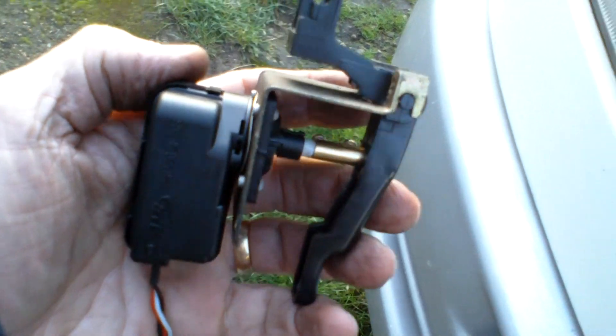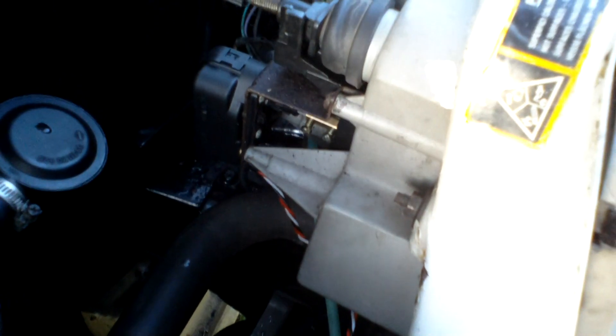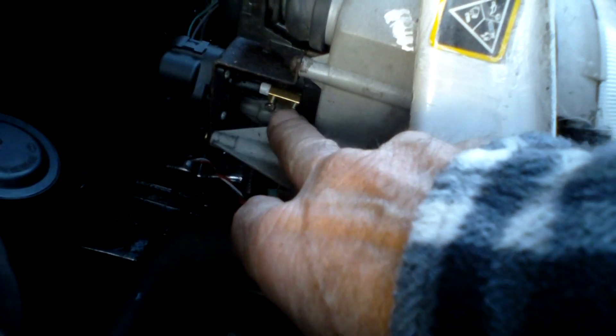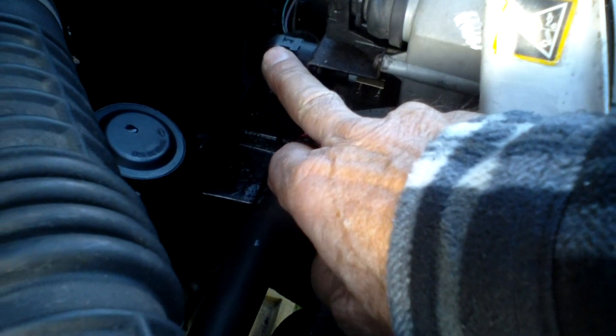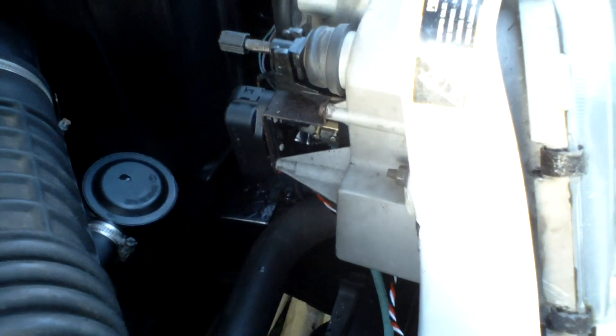Right, that's the unit — I've already got one installed. I'm going to have a play about first. Can you just about see it? There it is. This is what it pulls and pushes. I'll keep my fingers crossed it's going to work. I've made sure the adjustment is here — that brass tag I've used as a joiner, and I've got a little bit of adjustment on that too, because you don't want the motor to stall. If it stalls, it's going to burn out the potentiometer.